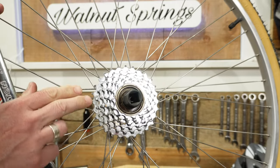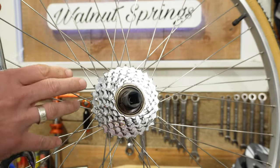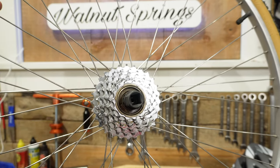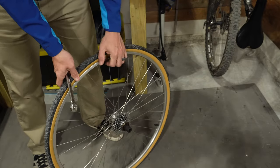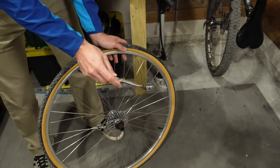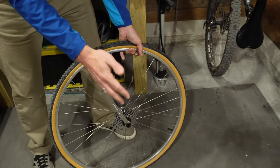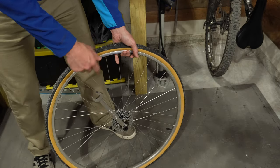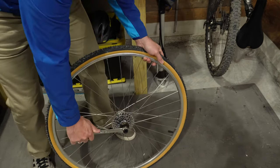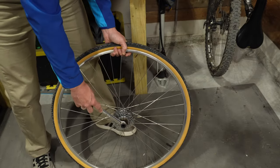Now sometimes these can be very tricky to remove, especially on older bikes, and you may need to get a cheater bar or some sort of extra long wrench to break it free. This is a newer one so it's fairly easy to remove. With our wheel on the ground and the freewheel tool installed, we take our 21 millimeter wrench. Remember that it is a counterclockwise removal, so brace the wheel and give it a good push. It can be on there pretty tight — even new ones can be tight, and older ones often require a breaker bar.